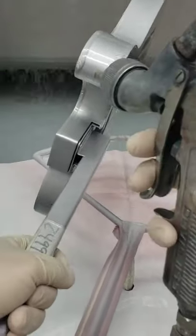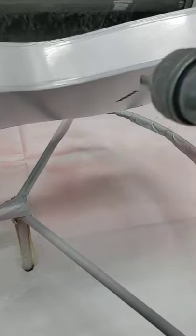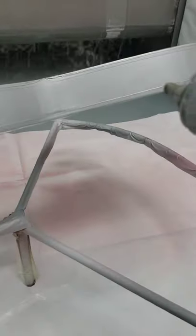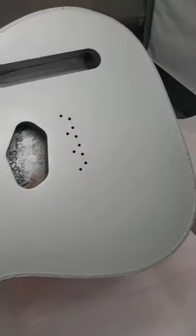Look right there. Again, see — even if it does drip down a little bit right here, not the end of the world, because sparkle is going to hide all of that. But still, not something you want to really shoot for. I went a little hog wild on this one, but all those imperfections and runs — see how I skinned them over with air — then you just fog another coat on there, and the darker areas where all that paint collected just go away. All right there, silver sparkle.